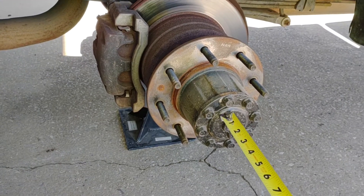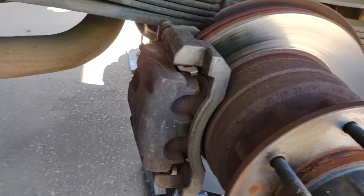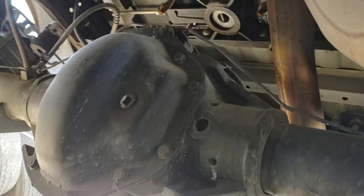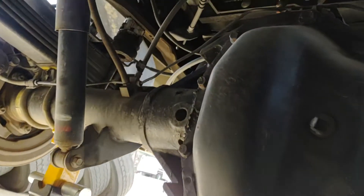From the front side, they're 2 and a quarter. Quarter inch thick flange. Full floater axle — comes all the way to the outside. It is a Dana. Every one I have seen, that is a Dana. It has a Dana symbol on the pumpkin, right in the center, right there.